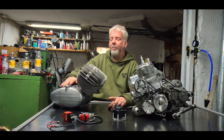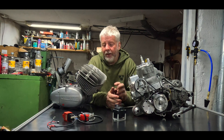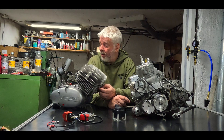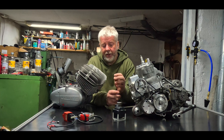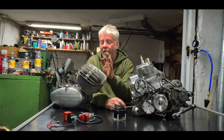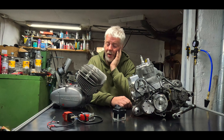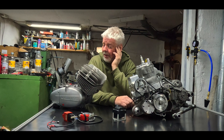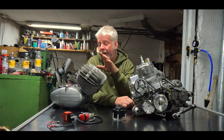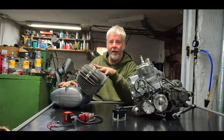People are saying no one has made 20 wheel horsepower with this cylinder — it's a Superterm Athena, six transfers and one exhaust. This has a Sax head — it doesn't matter, I will modify probably everything to get where I want. It's a four-speed engine, which is good enough. I will make brackets and mountings to be able to mount this one in the cafe racer as well.